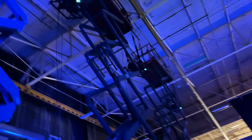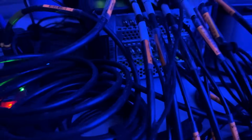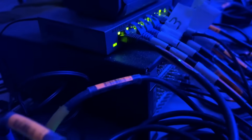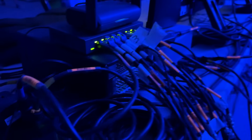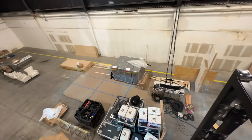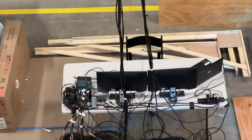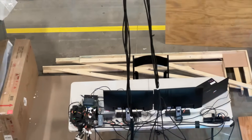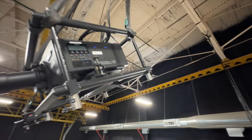For the computer to run all six projectors, we used a MacStudio M1 Ultra with a Sonnet enclosure and two Blackmagic DeckLink cards. These happened to be the 8K cards with many SDI outs, but any DeckLink with enough outputs would have worked. We ran three cables to each projector: one cable for power, one SDI for video signal from the DeckLink, and one ethernet cable to control all the functionality of the projector, like powering it on and off and controlling the lens and image setup.